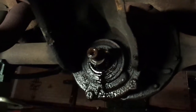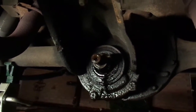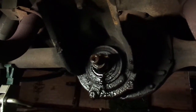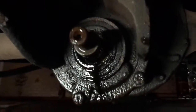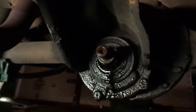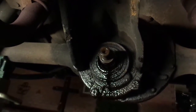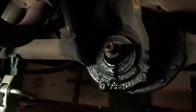I finally got the yoke off. My puller just about gave out on me. WD-40 sucks — I switched over to garage door lubricant, which actually keeps its viscosity, so that made everything slide right off. It worked really good. As you can see it's pretty stinking grody, and my mark did wipe off that shaft there, but I did mark it straight up and down, so I will remark it before I get too much farther.